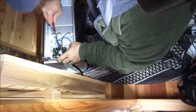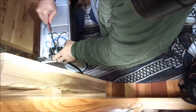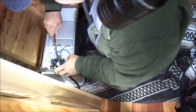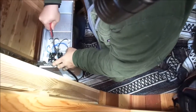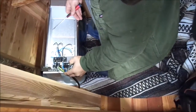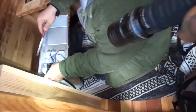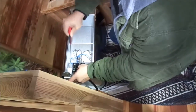It's created in such a way that this stove will not operate at the same time as the other heaters — it's either/or. The reason for that is because otherwise you would need a huge set of wires. This heater is for the steam generation — or even traditional, without steam, it'll just heat up. And this is where the rocks set in — rocks go on top of this one.